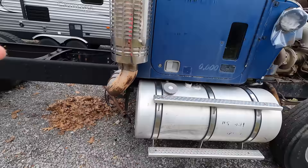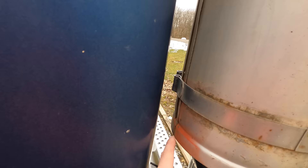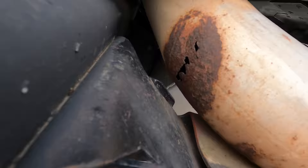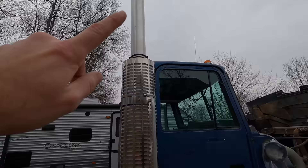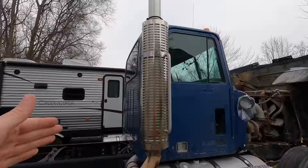We've got our secondary gas tank and the stack. This is the original muffler from the '80s — we know that because there's red overspray from 1985 when it was painted red for Steel Collar Man, still there today. This pipe is original but has a giant hole in it that I put foil tape over so critters couldn't get in. We have a replacement pipe we need to get installed, plus the correct 36-inch straight pipe with the rain cap on it, which will clear the sleeper.